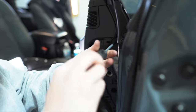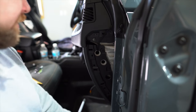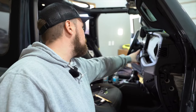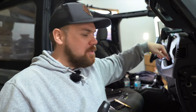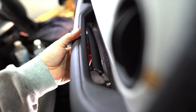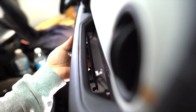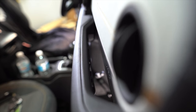The dash is more involved to pull off. Start by removing three screws on this side. On newer JLs it's all one piece — not two pieces like before. There's also a false compartment behind the oh-shit handle area that houses three Phillips-head screws coming in from the side. Pop that false compartment open with a trim-pry tool and remove those three Phillips screws. Hopefully this saves you time if you're ever ripping apart your dash.